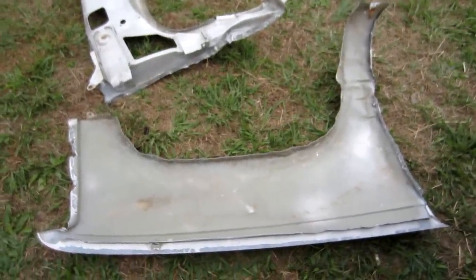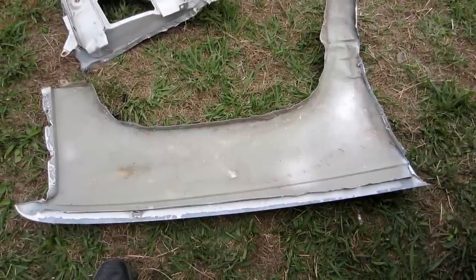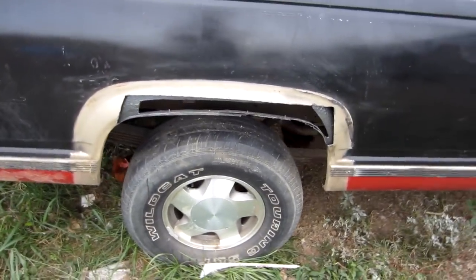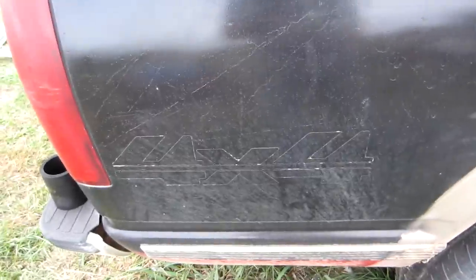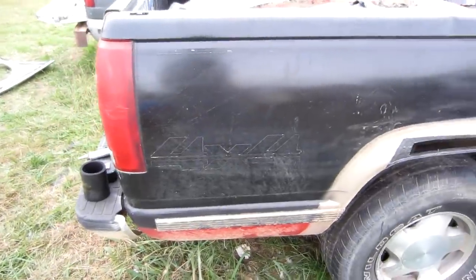This one's gonna be the easy one. The other one's gonna be kind of hard because I won't have that inner lip to use. What I'm probably gonna wind up doing is tracing the pattern — since I got this one off, I'll just straighten up that edge and trace me off a pattern with it out of cardboard. That'll make it a little easier up top. It shouldn't be too awful long till we've got them all patched up and ready to put the goop on to seal it up, scuff it, and paint it.